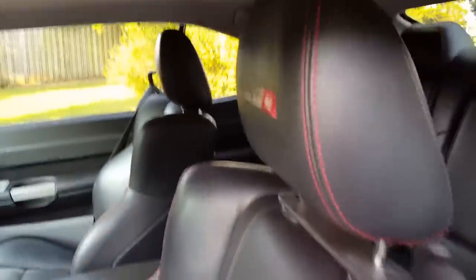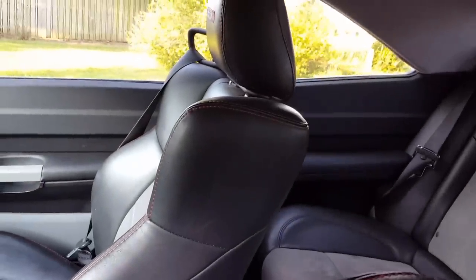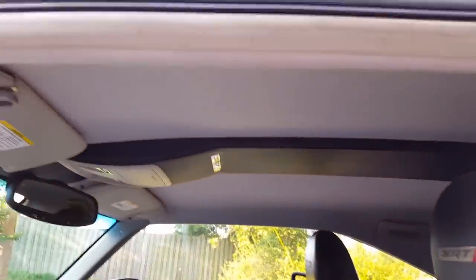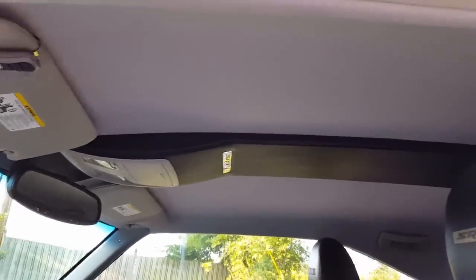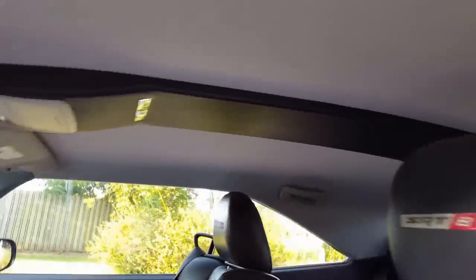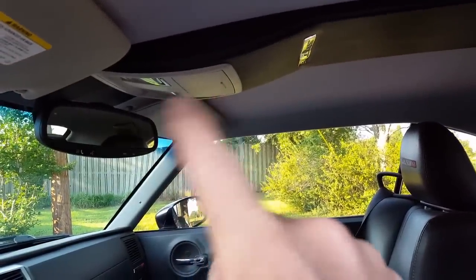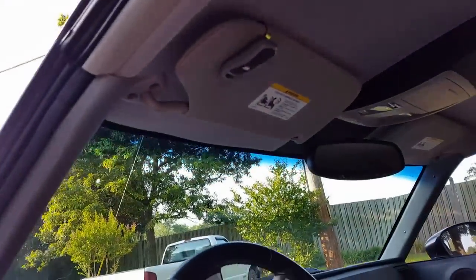And also, it's kind of hard to see inside the back where there would be doors, obviously. I had to make those covers and armrests. And also, I had to custom make this headliner and made that out of sheet metal. I split it in two because it was a little difficult to put a one-piece headliner in here. So I put a small overhead console in, which carries where you put your glasses, and your map lights and so forth are up in there.